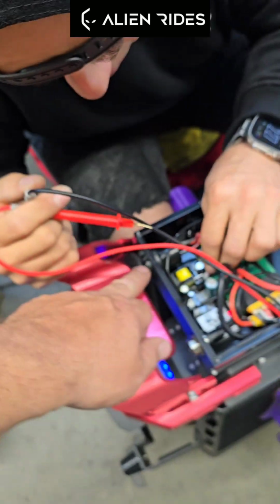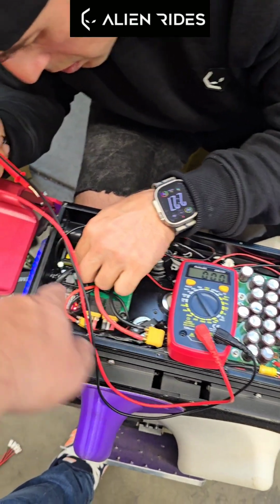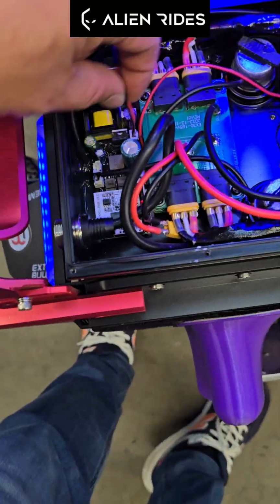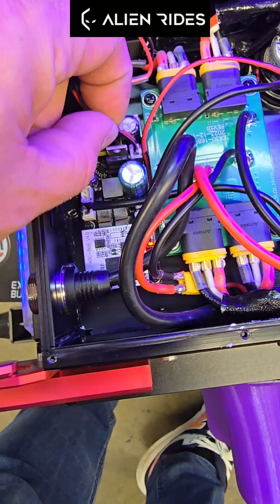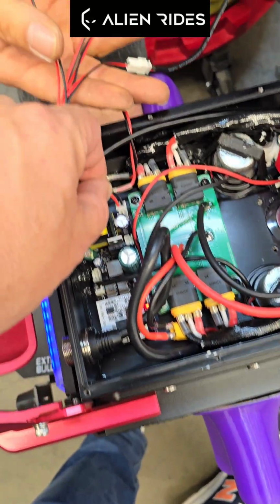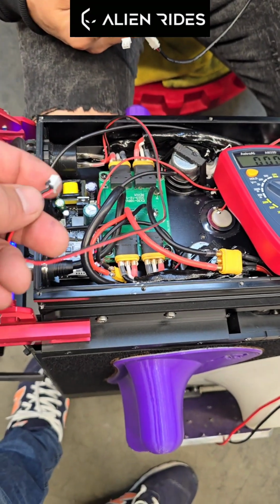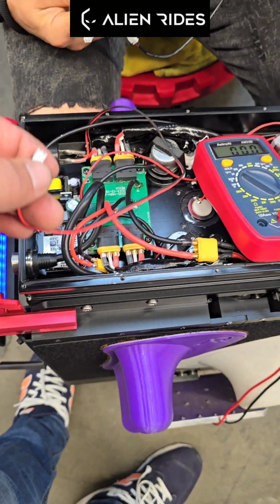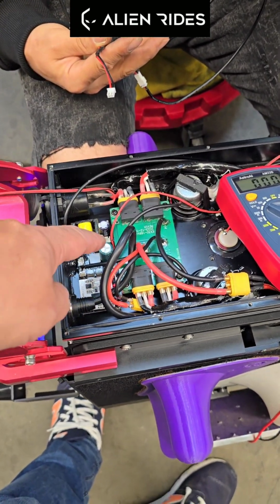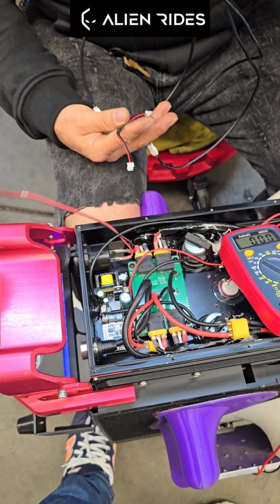This is made for a motorcycle or a car. So I think we're gonna have to modify these harnesses and give you 1 in, 5 out unless we can find another 12 volts present on here, and we'll look for that right now. All right, so we're powering 4 off of this plug down here on the auxiliary board. Don't do any of this work while your machine is on. This port only has about 200 milliamps of power, so it will not power it. To make this light kit work, we have to kill the option for USB. We may be making a special harness that has 5 outputs. I gotta confer with Bagode to see if this can handle these 4 LEDs plus this. I'm assuming you will lose this for now. We'll have more on that soon.